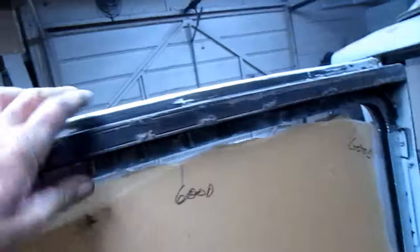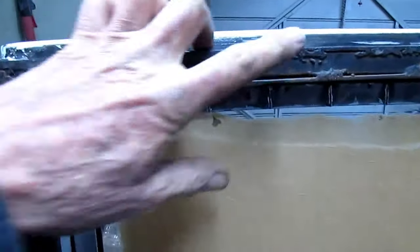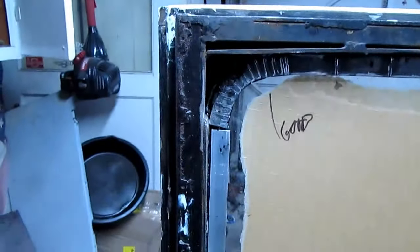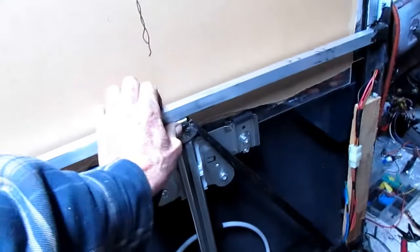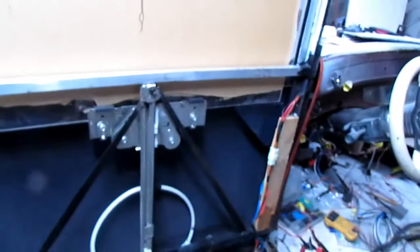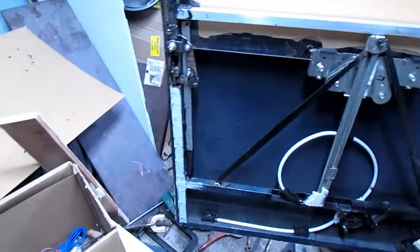This steel plate they've got welded in here is a little bigger than the door. So I'll just clean this all up here and coat this whole outside of the door with bondo — that way I can get it all straight. I really don't need to do this top part for now, but I do need to clean up the bottom. Because my next deal here is I've got to put this bottom door panel on. So I'll cut that to the right shape, and we'll just end this video here and get it uploaded.